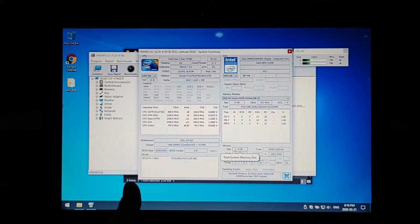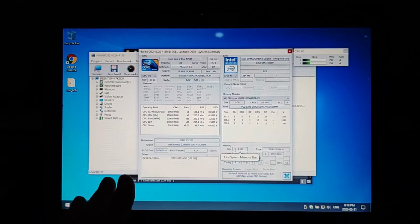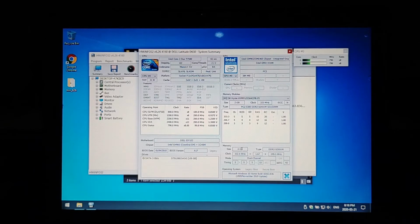That's right. But because I'm running a 32-bit version of Windows installed on this system, just to keep the performance as clean as possible, it's only recognizing about 3.5 gig worth of the memory from an addressability standpoint. So you could install a 64-bit version of Windows instead on this system, and I believe it would have the capability of installing up to 8 gig of RAM as well. So again, 8 gig of RAM, it will support an SSD because it's got SATA capability,